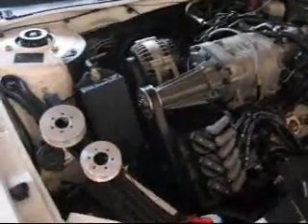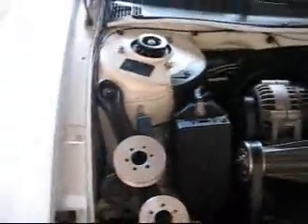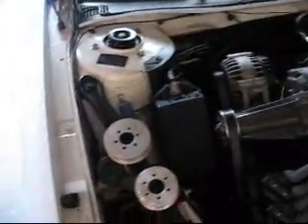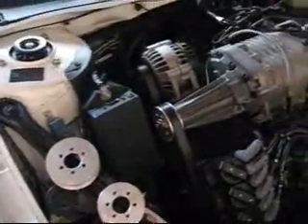With a modular system you could mod slowly at your own pace. I personally started off with the 3.5. I ran that for about a year with supporting mods. A 3.5 inch pulley is good for about 20 horsepower. Most people run the 3.4 which is good for 25.